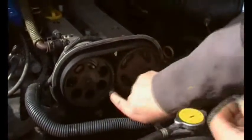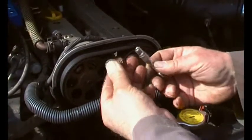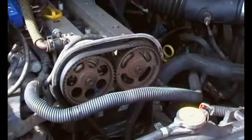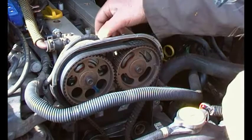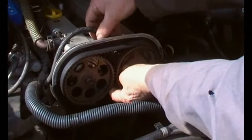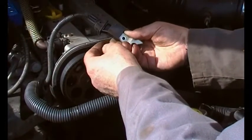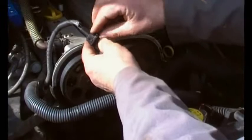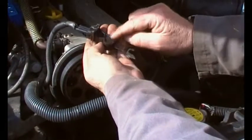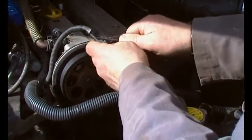I've removed that little screw from in there — it's a torque head, it's an E8. Now it's not very easy to see how this cable is attached, so it's best to fiddle the whole lot out. There it is — there's the cam sensor. We'll just turn it over and there's the wire clip — the clip is on the side of the encapsulated bit — and there it goes.